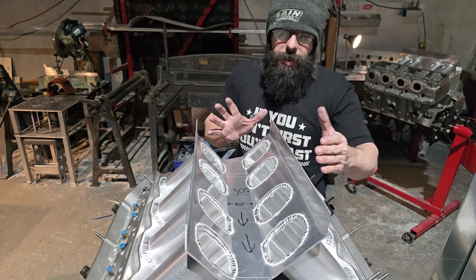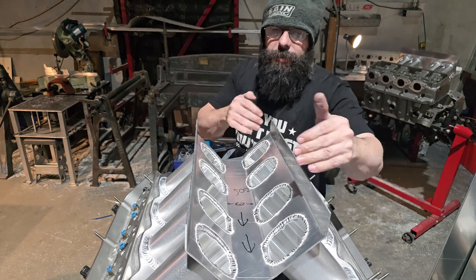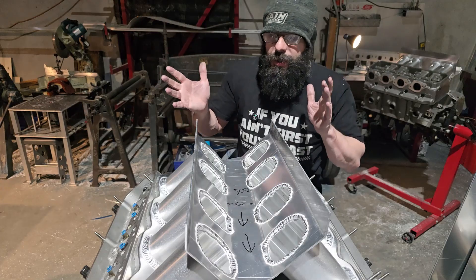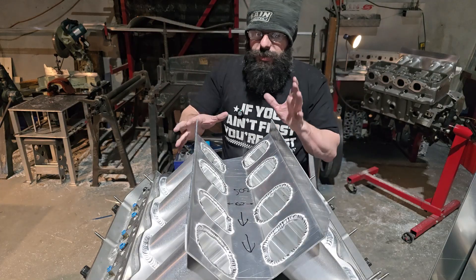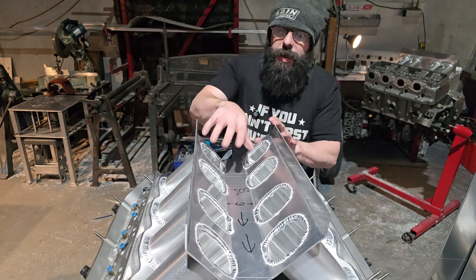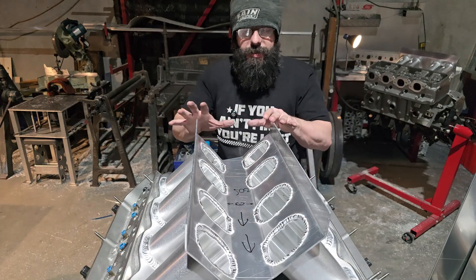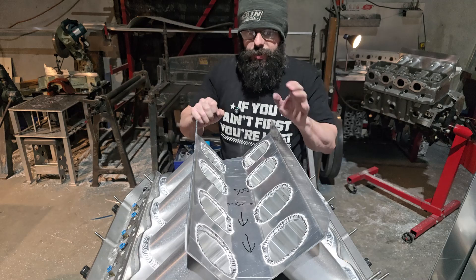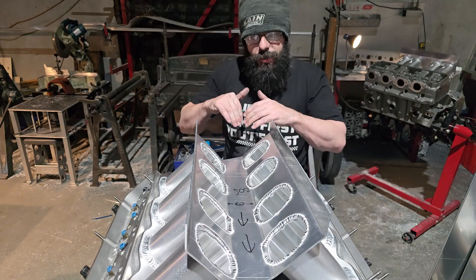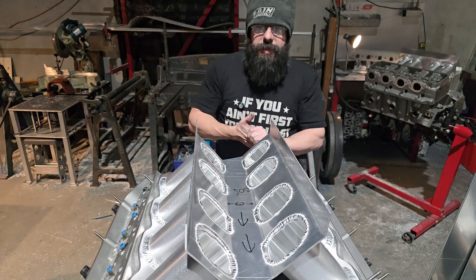This plate will shrink you 40, 60, 80 thousandths, so when we do the CAD we have to make the rim longer and wider than the top carby plate. That just comes down to experience — we've been doing this for a couple of decades. This series is more about induction science, but I'm giving you a rough rundown of what's to come. From here we'll weld, then port and start forming the radius, then texture it. I like a 70-degree radius — not a full radius — so I finish with a sharp edge.